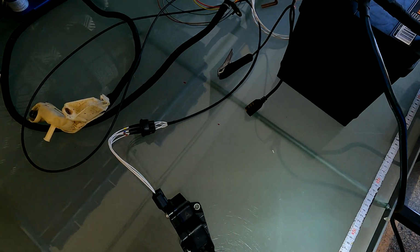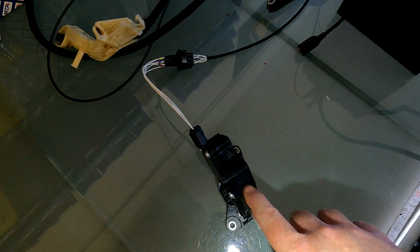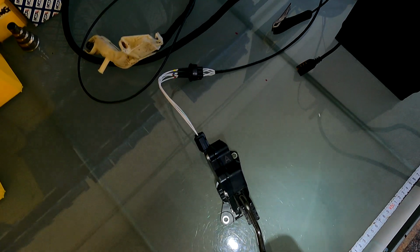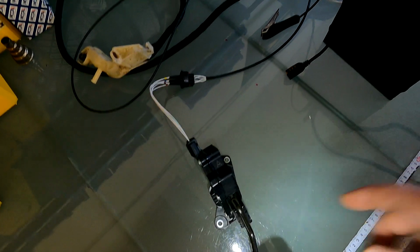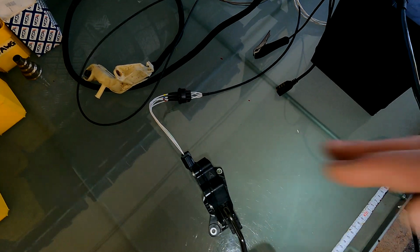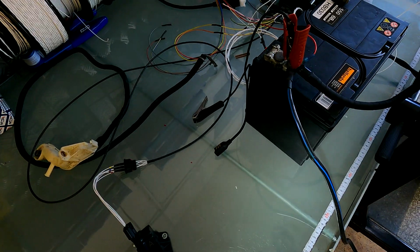And that's to do with the way that Toyota work the signals up. There's two signals for the pedal, and there's two signals for the throttle body itself. That's a safety precaution. The main signal goes from 0 to 5 volts. The other one actually tops out before that, at about anywhere from 75 to 85%. So when you go foot flat to the floor, you're not actually seeing the first signal. As far as I'm aware, you're seeing the second signal, so that tops out and then levels off. Even though the pedal's going more, it hits a point and then levels off like that. So people get confused all the time. They don't see 100% on the diagnostic machine.